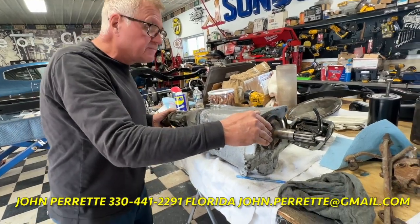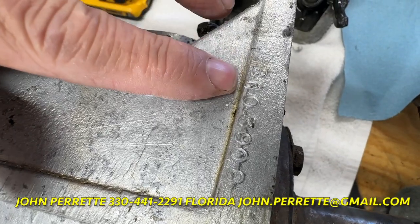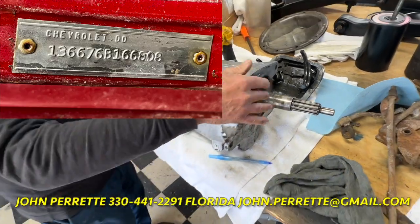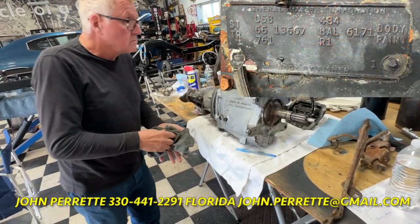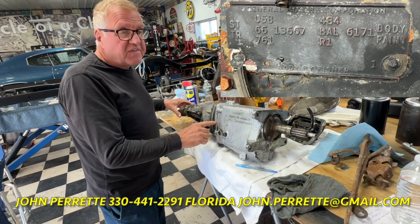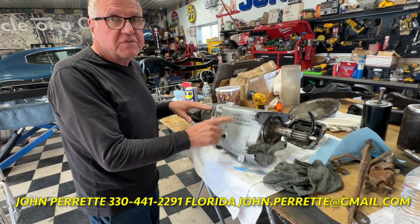If you look up here at the top, you'll see the VIN number of this particular transmission. It starts with B, meaning it's Baltimore, and it was the 3,908th car that came off the line. So it was originally in a car that came out of Baltimore. Now our car was Baltimore and it was built in May — that would have been May of 66 — and that number does not match up with the serial number on the car. This transmission was August of 65, so it was way too far in advance. Furthermore, the 325 cases did not go into 66 cars — they were zero.